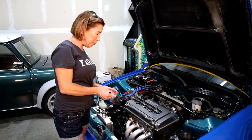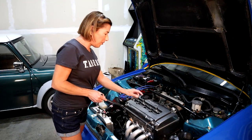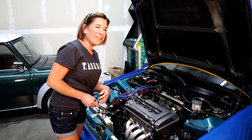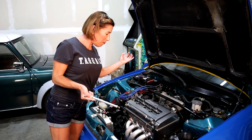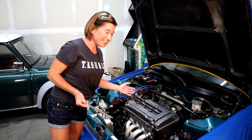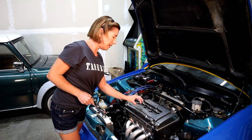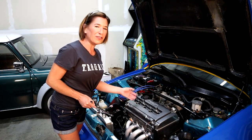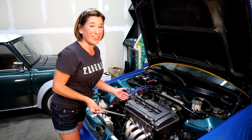There are two more things before we insert the tool. Remember those little acorn bolts I took off? Make sure they're at least a mile away - don't set them here, don't set them on the corner, don't even put them on the corner of the hood, because they will magically fall into your hood or your head, and you're screwed. Also, it's probably a good idea to wipe a little bit before you begin as well, because we really don't want dirt or schmutz falling into the cylinders. This is just super expensive if it messes up.